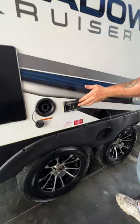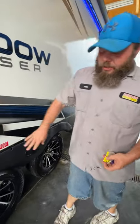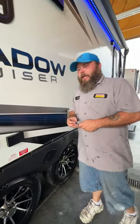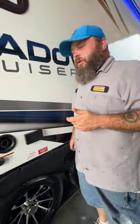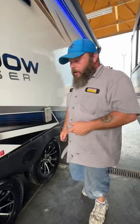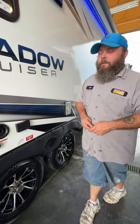You do have an outside 110 outlet that is GFCI protected. There are notice and attention stickers here to make sure you periodically check your lug nuts. This sticker wants you to check them at 10, 25, and 50 miles. I always recommend checking them around 50, 100, and 200 miles. A good tip: when you leave the campground, your first stop is usually the gas station to refuel — check the lug nuts there and knock out two birds with one stone. You also want to keep these tires topped off to their max PSI of 65. Lug nuts are torqued to 100 foot-pounds.